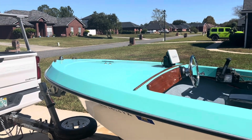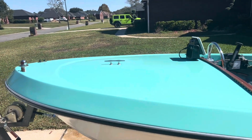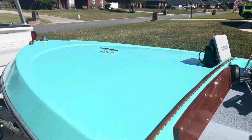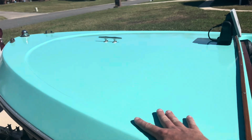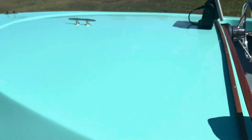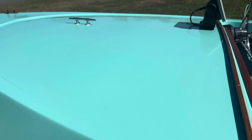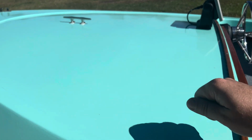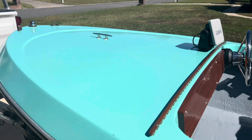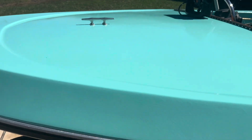It was awful. Probably to do with the heat and the humidity at the time when I had to apply it. But you figure you make a boat paint, you should be able to apply it in high heat and high humidity. But this stuff was terrible. I thinned it out with their thinner and did everything like I was supposed to do, and it was just terrible. You'd roll it on once, and if you waited more than 5 or 10 seconds and happened to touch that spot again, the paint just peeled right up, and then it started to cauterize and clot, and it got thick and bubbly and nasty and got all kinds of texture in it. It was a nightmare.